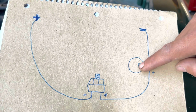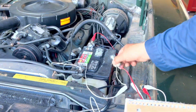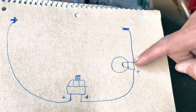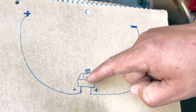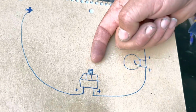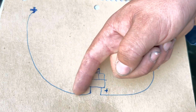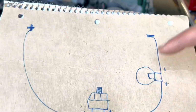And we have connected it to the socket on the light bulb, which is this one right here, and then the light bulb is receiving the negative from the battery. So it's getting the negative and it's connected to the sensor, but once this sensor works, it's going to allow the positive to flow through. So we're going to push and simulate pressure and see if the current, the positive, continues through the sensor. Once it receives pressure, you see the light bulb turns on.